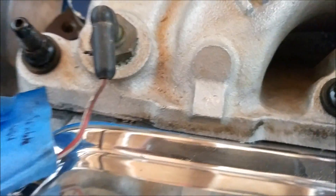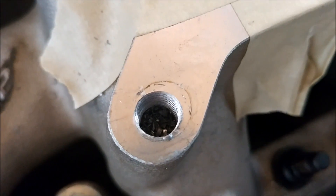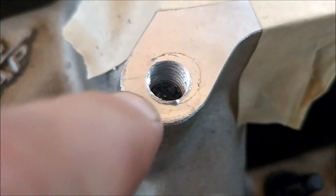You can see how good the threads came out — there's some aluminum debris I need to remove. There's a small lip right here around the hole opening. Our gasket should take care of it, but better safe than sorry, I'm going to file it off.